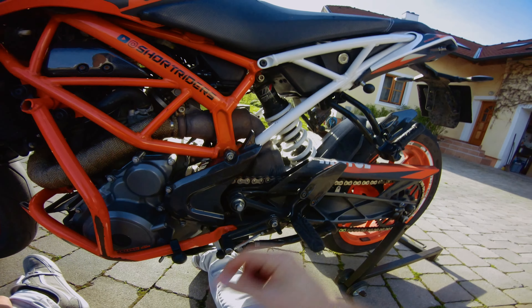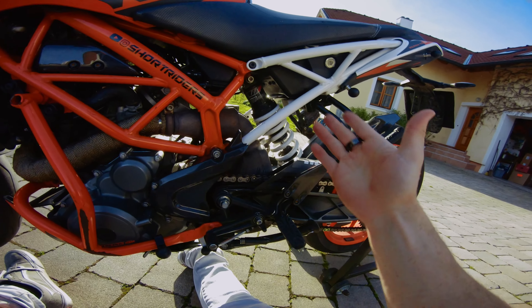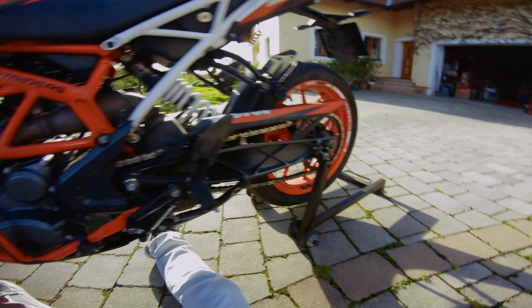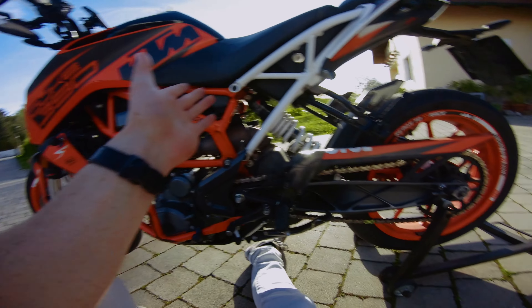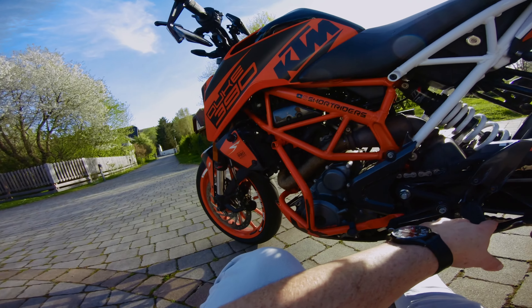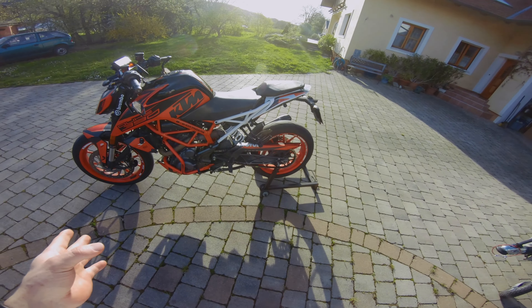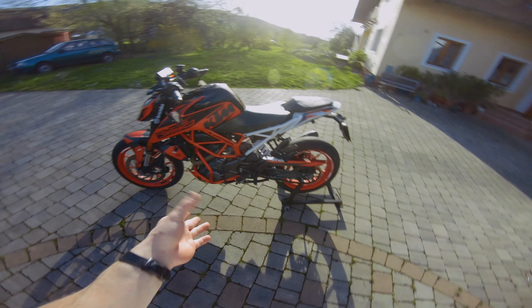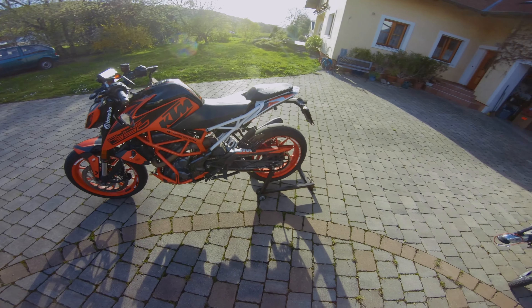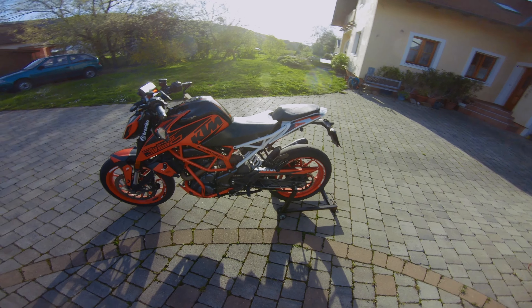For the brakes I didn't change anything except the brake pump on top. For rear pre-load on the spring I run it on middle — I've tried hard and soft but don't feel much difference between them, so mid works perfectly for me at around 75–80kg with gear on.